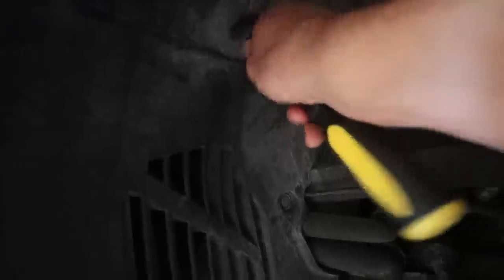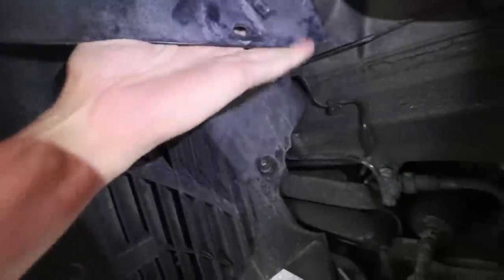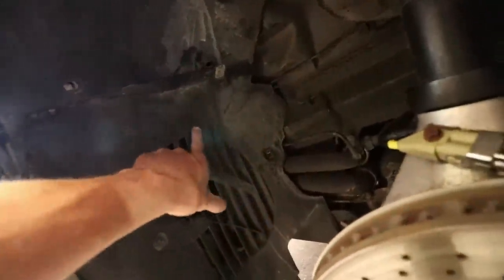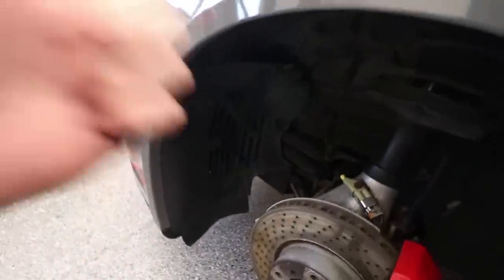Got those bolts off. With my flashlight, if I pull this down you should be able to see the cable right there in the center of the screen — that is the cable you want to pull. It's right behind there and it's kind of hard to pull with your fingers, so I have some vice grips to clamp onto the cable and yank it. There we go — easy as that. Now I just have to button it all up, tuck the plastic back in, get the wheel back on, and then we'll be in the front trunk.